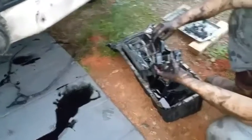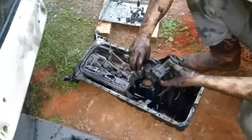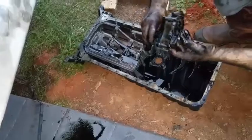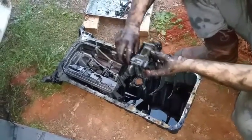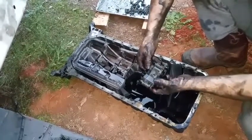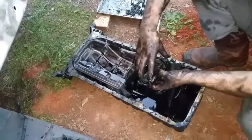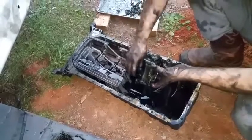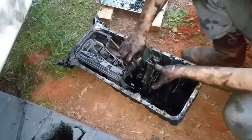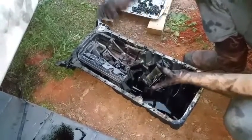The engine oil pan is finally out. You can actually pull it out, but there's a piece located right beneath the oil pan — attached to the block at the bottom where all the crankshaft stuff is. It sits inside and when you try to pull the pan forward, it bumps right into that piece, which is the problem.